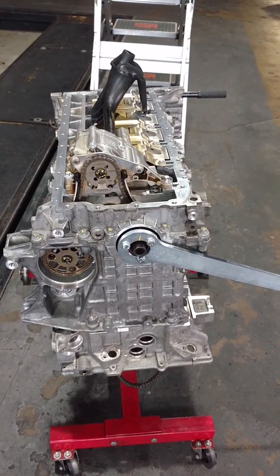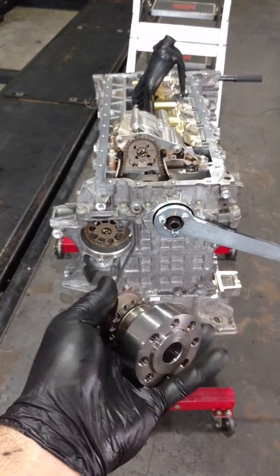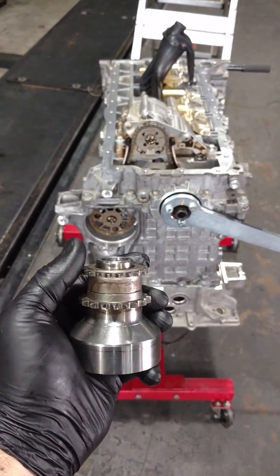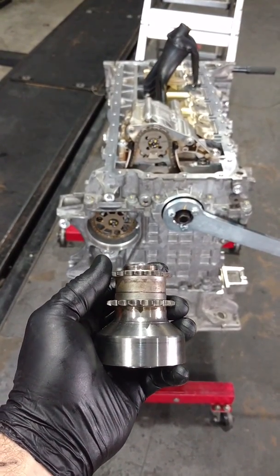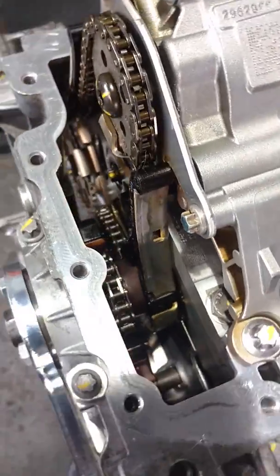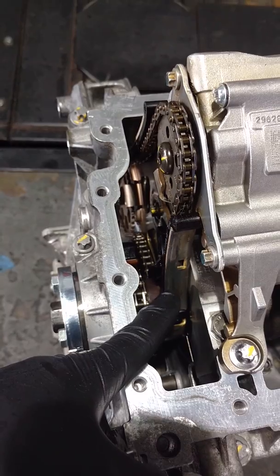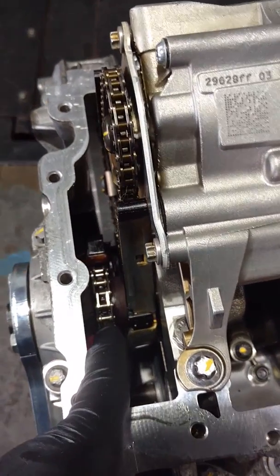You've got to get the chains on the crankshaft. So what they did is they came up with this — it's a hub. It's actually a hub out of our S55 M4, but it's the same system. They take this and cut it off the front of the crankshaft, and that allows it to come out. You can see that is the timing chain for the top of the engine, and this is our timing chain for the vacuum pump and the oil pump — but you've got to get it on there.